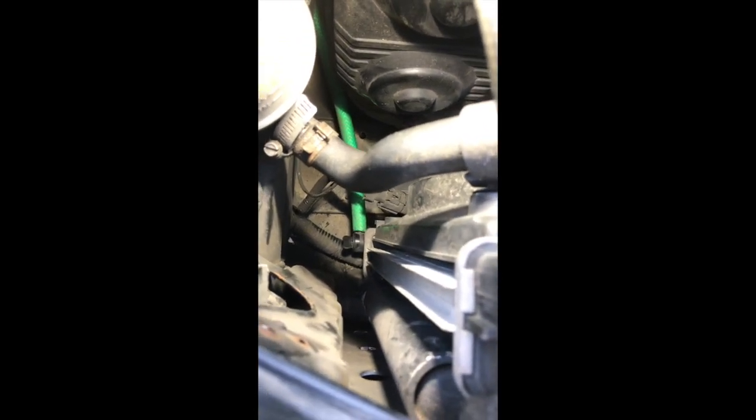I'm going to drain the radiator now, and I've put a hose over that access point. It won't catch everything, but it's really just to try and minimise what goes onto the bottom. I've also got another container underneath the splash guard because I'm too lazy to take the splash guard off, and run the hose into another container outside of the car. So we're just going to twist that key now until it comes out, and hopefully let all the coolant drain.